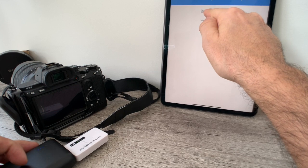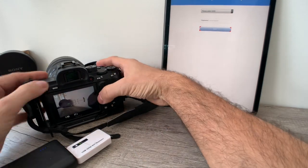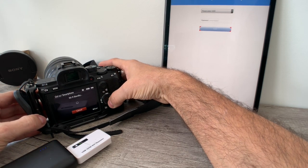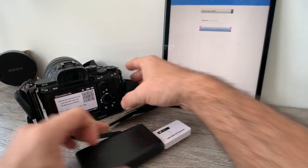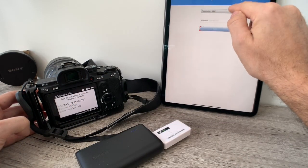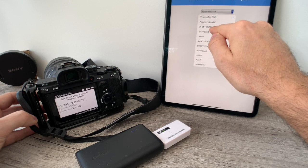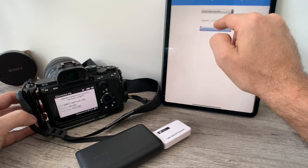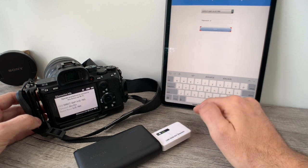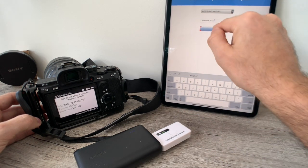As you can see here, it says please select SSID and the password. At this point you're going to want to turn on your camera, go into your menu, go down to Control Smartphone, go to Connection, let the Wi-Fi turn on. Press your delete button so you can see the password. Now go over here to select SSID and find it — there it is: Direct QBILCE7M3. Click on that, it's going to ask you for the password that is on your camera. Everyone's is different. You don't have to worry about security too much because this is basically just for your camera access.